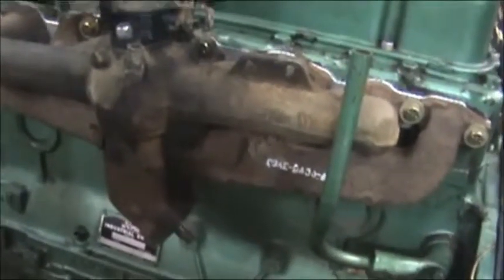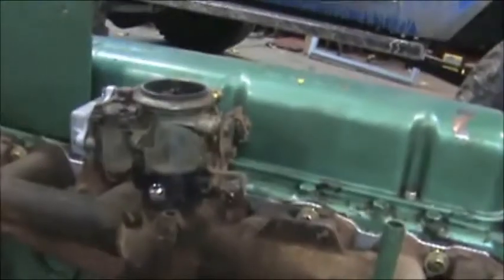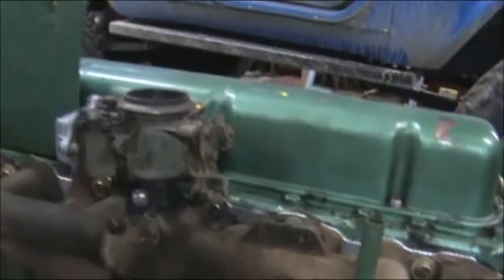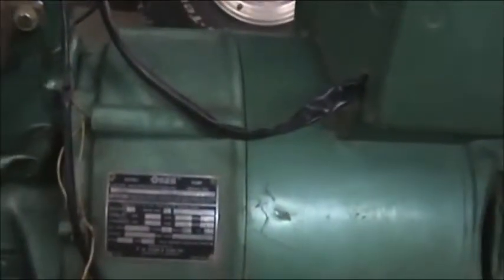Some of the main parts I didn't get with it were the intake and exhaust manifold and carburetor. I've purchased both of these from eBay and got a carburetor rebuild kit and got that together. I had to bolt it all up — the generator part was off and it needed some brushes and the bearing on the end cap. Got that in there, got it all together, and tonight was hopefully going to be a successful fire up.